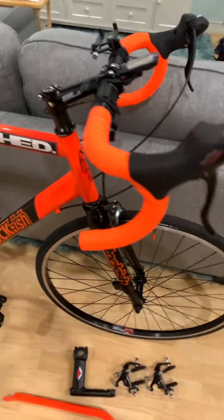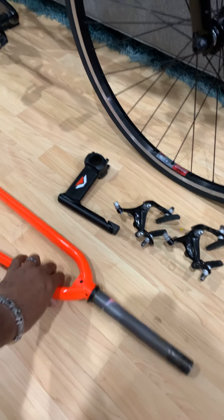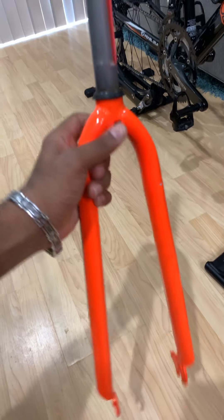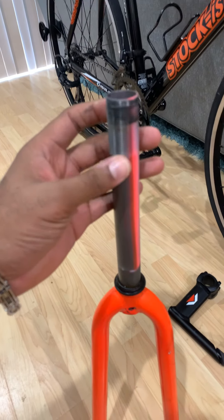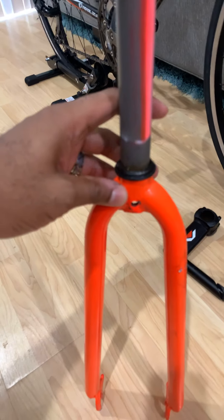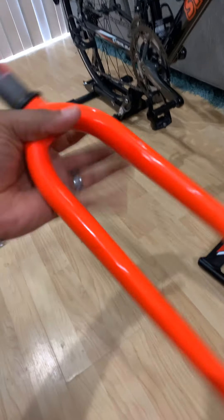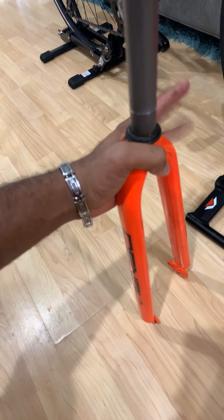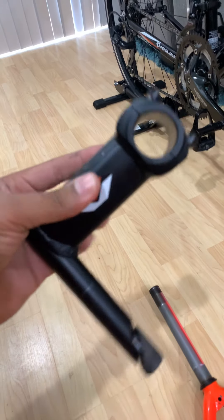This video is going to highlight the last things that were changed out. That includes the front fork — this is the old front fork. You have a one-inch steerer tube right here. This is steel — Denali steel — this is what comes on the bike. This is a one-inch threaded steerer, and the headset is also a one-inch headset that was on here originally. This had to go because it is very heavy solid steel. The quill stem that goes with it is actually aluminum — still a very outdated design.